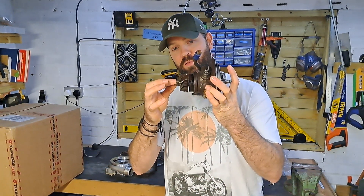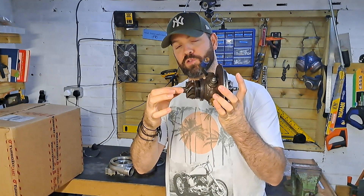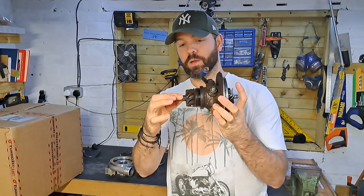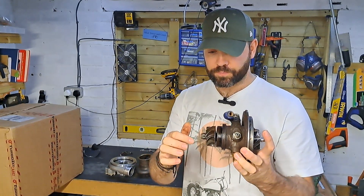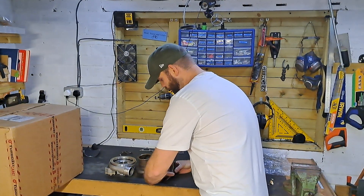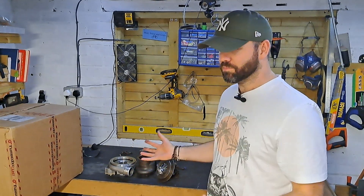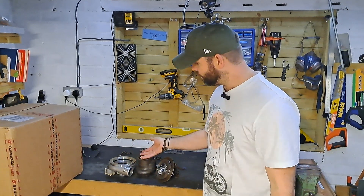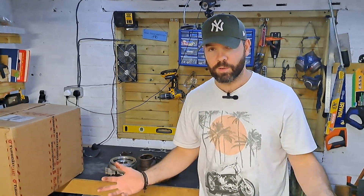Essentially what I've done — hopefully if I spin this round, if you look at the exhaust wheel here, the exhaust wheel is now wonky. I've bent the shaft, and I did that through taking it out. I'll show you in the other video in a bit more detail when that episode comes out, but I'd really like to get this fixed. The exhaust housing is good, compressor size is really good, the compressor wheel is really good. There's nothing wrong with it other than a bent shaft.